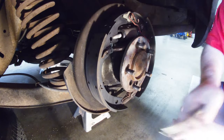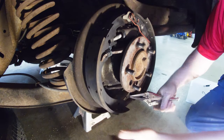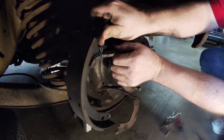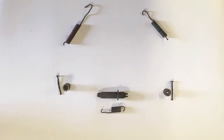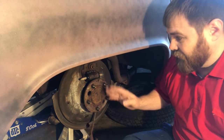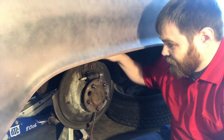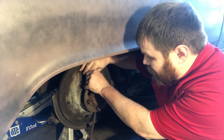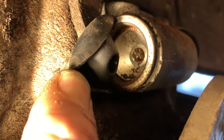I've got to take the shoes off to be able to present them for a lifetime warranty to get them replaced, and I make quick work out of getting them off the car. Another thing I like to do is lay out hardware as it's removed. So we're here on the problem side — I've taken it all apart, then I gave it a Simple Green bath, and I'm glad I got to this point because when I took off this rubber boot, I found rust inside.